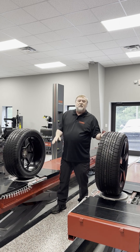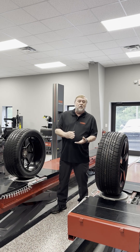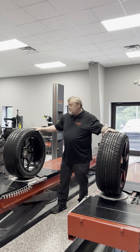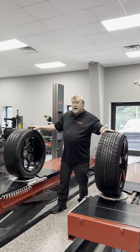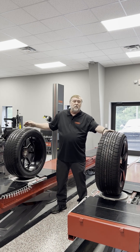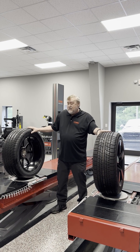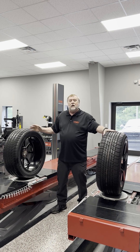Manufacturer's specs give you a tolerance. For example, with perfectly plumb tires, a camber of zero would be optimal, but you always have a spec that's plus or minus considered an acceptable level. For example, camber being zero, you'll have it plus or minus maybe 0.2 or 0.25. If it's both in at 0.25, it's within acceptable limits, or out at 0.25. Where you have an issue is if one tire has positive camber at 0.25 and the other has negative camber at 0.25 — it's going to make the wheel pull in one of those two directions, even though it's within specs.